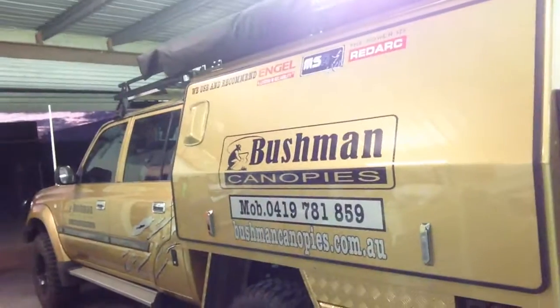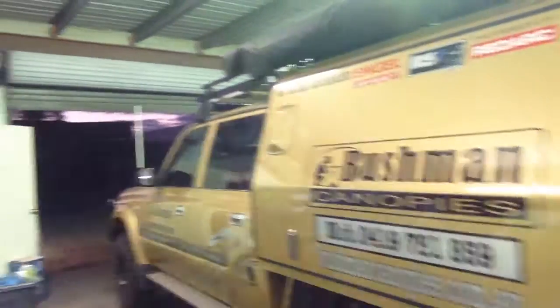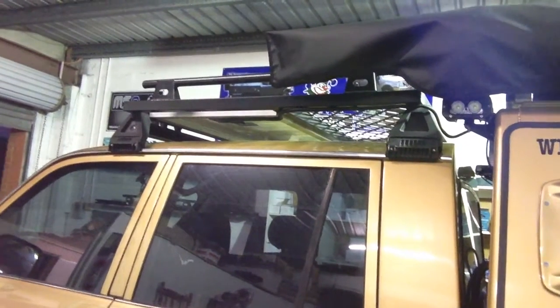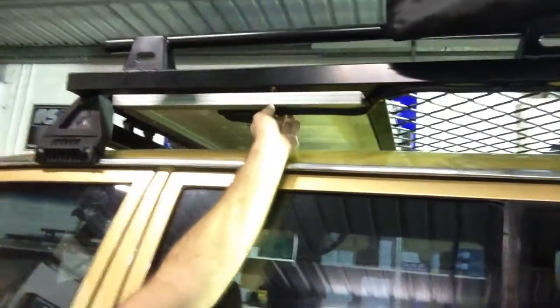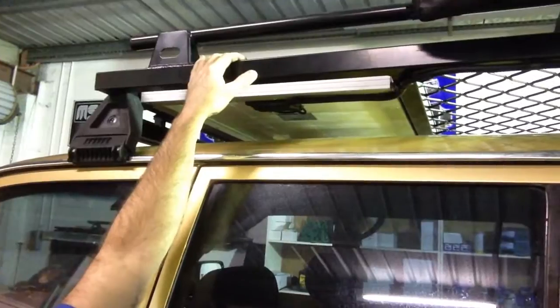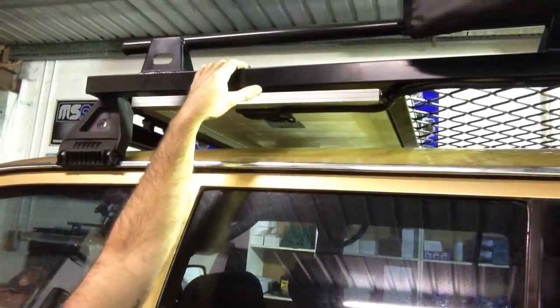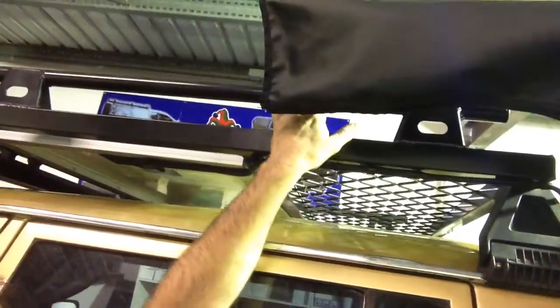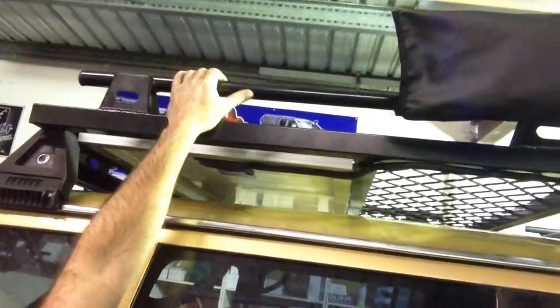There it is — factory turbo diesel wagon, chopped down to a dual cab. Starting at the front, you can see a custom built roof rack. That houses an 80 watt solar panel — the top of the panel sits 15mm below the rack surface so that should you want to put something long on the rack, it'll sit on the frame and not on the glass, so it won't have any adverse effects and you won't damage it. It's also got a mesh cargo area and heavy tyre rails on the side so you can really strap things down.